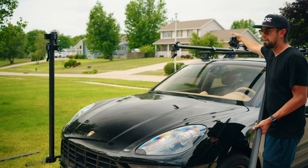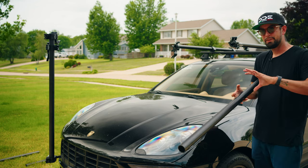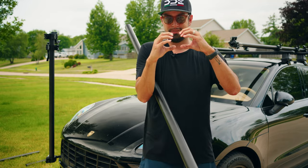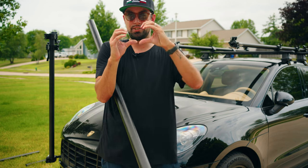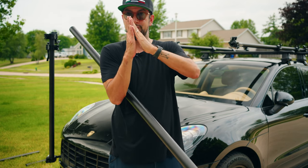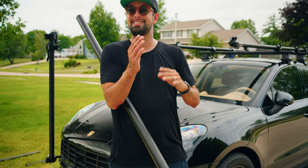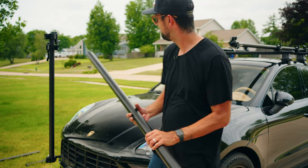So when I'm making this connection, there's something I might want to do before I tighten it. Instead of just leaving the two joints freely moving, I'm going to want to twist it so that the two plates in the middle, instead of being like this, one is pushing against the other. When you twist just a little bit and it pushes against the other, it stops that rattle. And now it's a firm connection. So I'm gonna put this in.